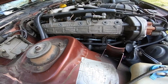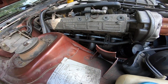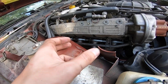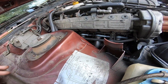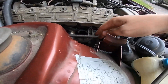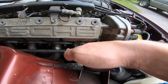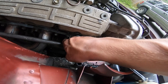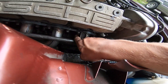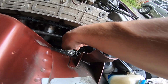Got it back on. It has to all go on at the exact same time, so it takes a lot of patience - you've got to be gentle and delicate trying to get it to perfectly slide on. Rather than shoving it up with my hands, I'm going to put the nuts on and tighten it down evenly to draw it up against there. Important tip: if you're putting this exhaust on your car, make sure you put the second nut from the front on first, because the exhaust tube won't allow you to get that bolt or washer on later. Do this before you touch any of the other ones.